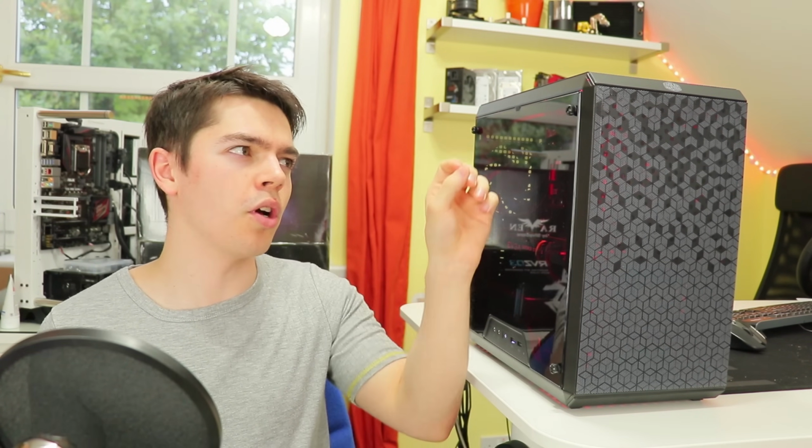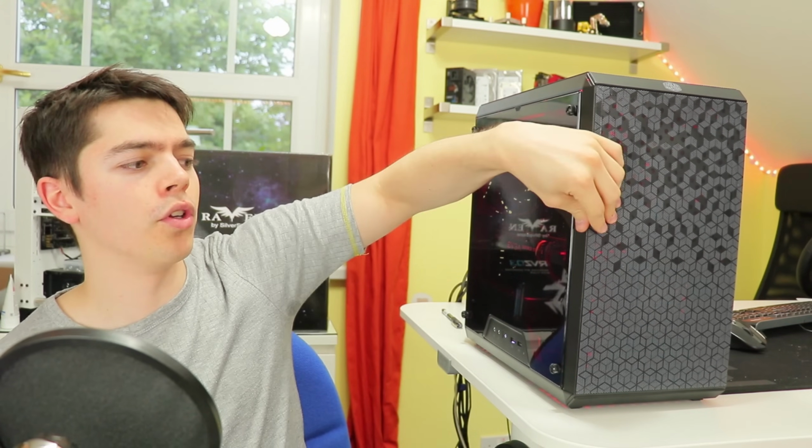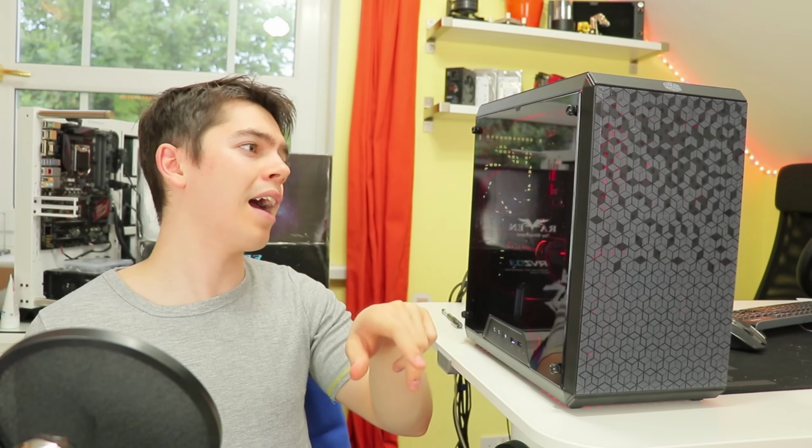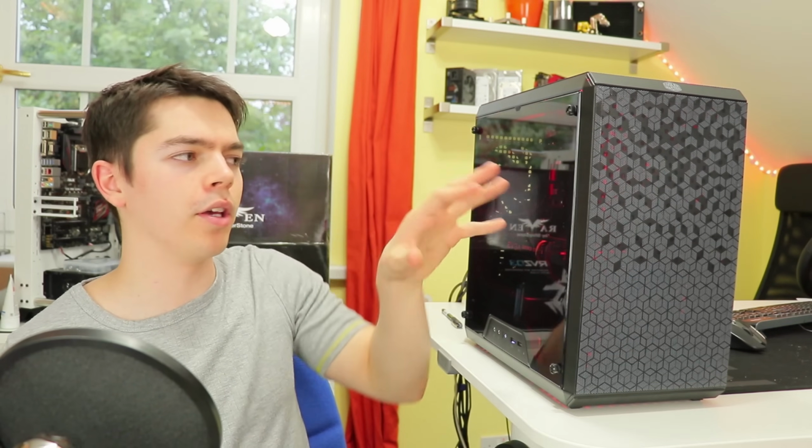The front fan mounting clearance, there could have been a recessed panel, a punch-out segment just so you don't have those issues with clearance. Even a couple of millimeter punch-out that would be accommodated for with the thickness of the magnetic strip. That would have been great to see, but they didn't do that, so you do have, they're not spinning now, but you do have issues if you were to knock it, and yes, you could break a fan that way, even though it seems so far-fetched.